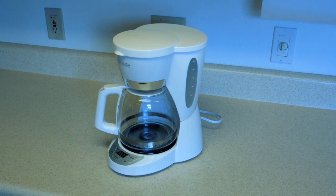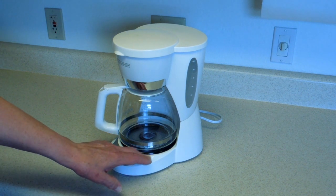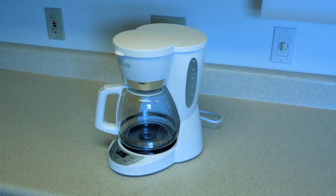I make a pot of coffee every day, so one of these things has a finite life at best. They will last maybe a year and a half, two years on the off chance, and usually they'll quit in the middle of a pot of coffee. The heating element goes out, or there's a safety device in here. Once it trips, it does not reset.